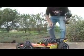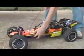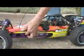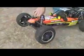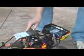First thing, as always, turn on your transmitter, so there's a signal already going to the vehicle. Go ahead and turn on the Baja. Switch is right down there. Just make a once over. Make sure you got your steering. Make sure you got throttle actuation. Good brakes. We're ready to go.